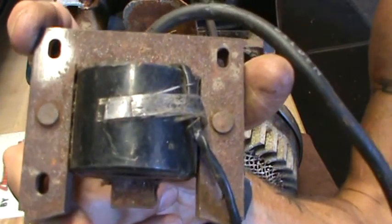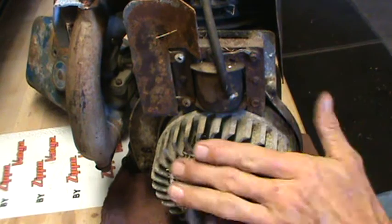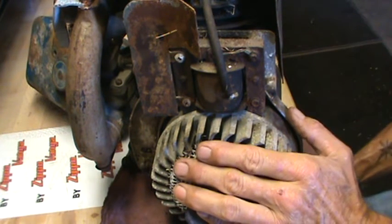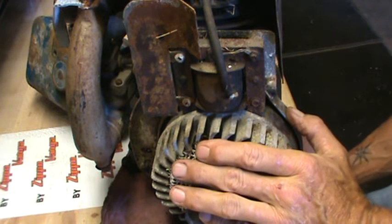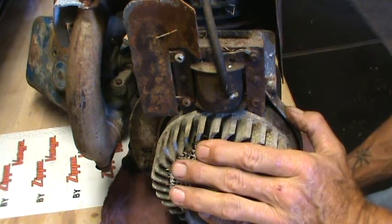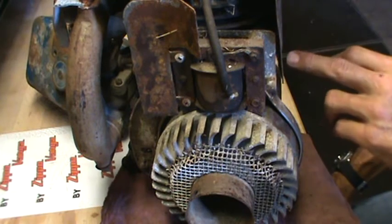The question that's come about quite often is on these D-type motors, like this Model 8 here. This is actually a Sears 500. 106030 is the model number, and the serial does not tell you the year — it has to be decoded. And this one's even got valve clearances written on the bottom of it.